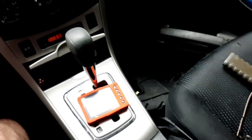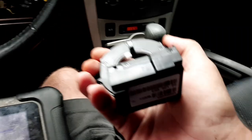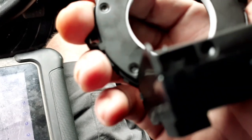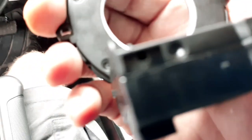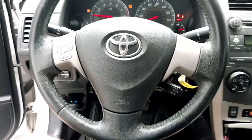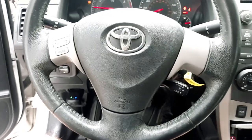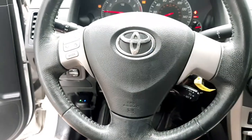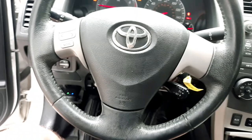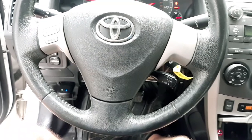The owner actually bought a new sensor for me to replace it. I ohmmed out the CAN terminals and ground on the new sensor, and there is no continuity between them, so this should be a good sensor. I just wanted to get this on video because I didn't show it in my previous videos — to prove that my theory was right, that the sensor was shorting out the CAN lines to ground.